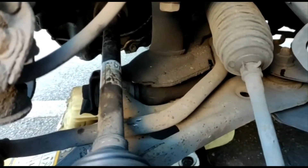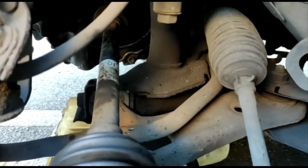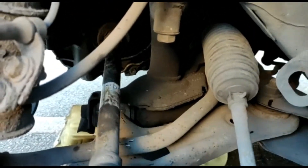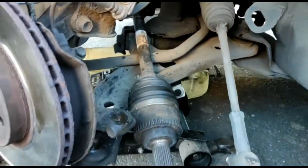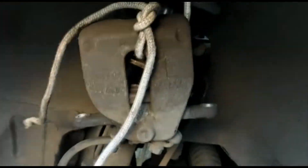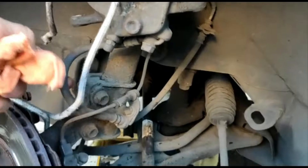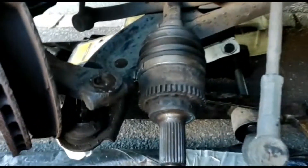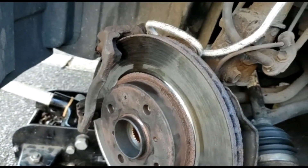We got play inside the diff — I can hear the bearing and the spline over there — so we leave that one as it is because it's going to clap soon. To remove the caliper, secure it on the top, reduce the pressure on the hose, remove the steering ball joint and the wishbone.